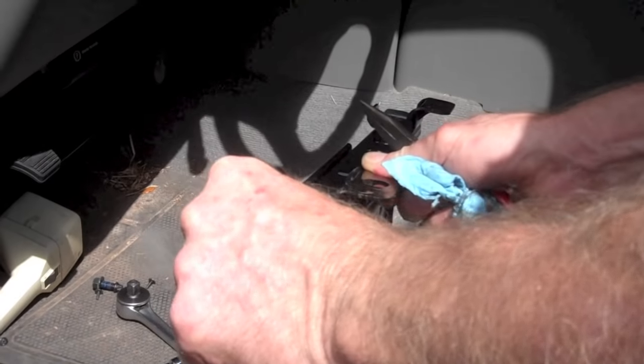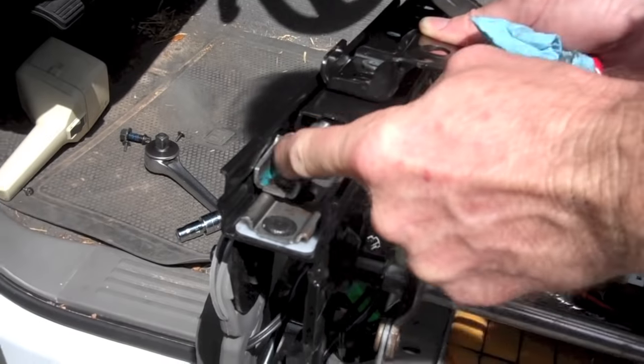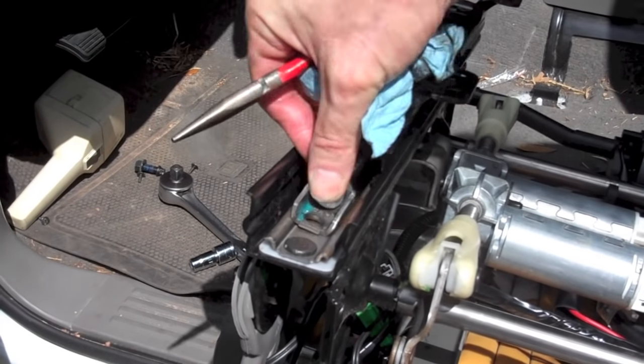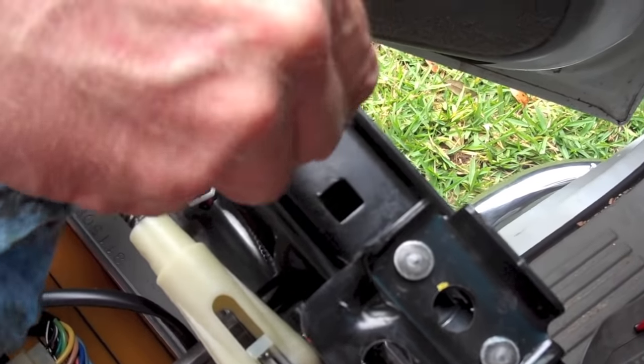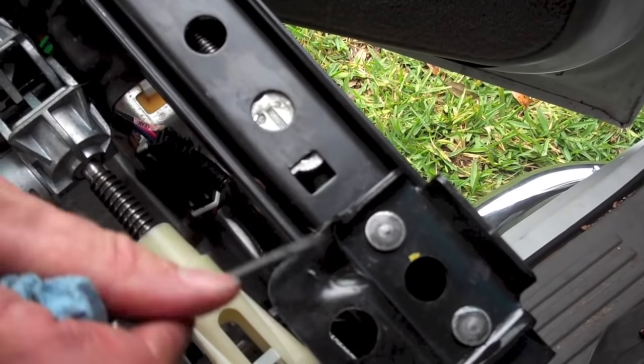At this point, you should find that the hole in the worm gear is too far back to line up with the hole in the rail. This is for two reasons. The first is that the front of the worm gear does not easily go into its support, and it will need some help doing that. I suggest that forceps would be a good tool to use for this.